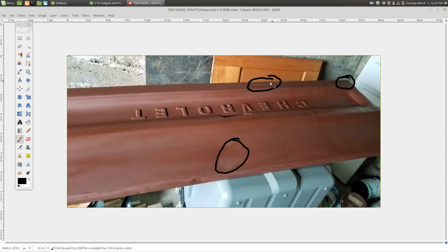And no, we didn't lightly spray the bondo areas first with the primer to let it set a little bit, then spray the tailgate. We just did one pass. That's all this was. We had a can of Rusty Metal Primer by Rustoleum, and we just sprayed one coat. We had some areas with exposed metal, and we wanted to make sure we covered them up. There's an area right in here with a good sized dent. We didn't even take it out. I just wanted Brandon to see that Rust-Oleum is actually a really good product, so that would end his worries and fears about using it.